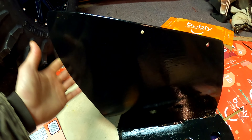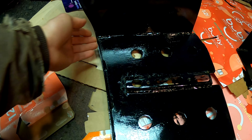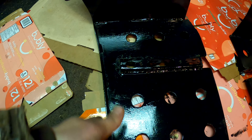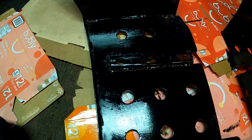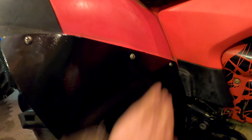The back piece you'll need to match up yourself and figure out the angles — it's a bit time-consuming. I suggest starting with the base first. I put a curve in the base too — I wanted something that looked cool with a nice rounded flow. You can make them any way you want. I'm going to throw these on the machine and show you the wheel clearance with the dimensions I gave you. The steps are on now — three bolts here and two bolts at the front for the rear plastic. You've got a u-bolt on the frame and two bolts on the factory peg.